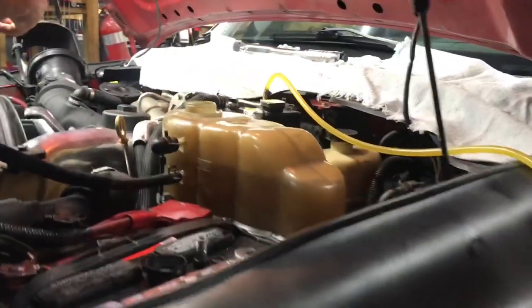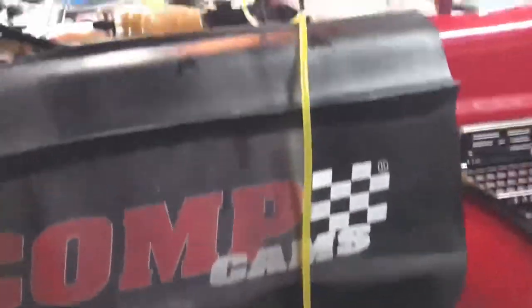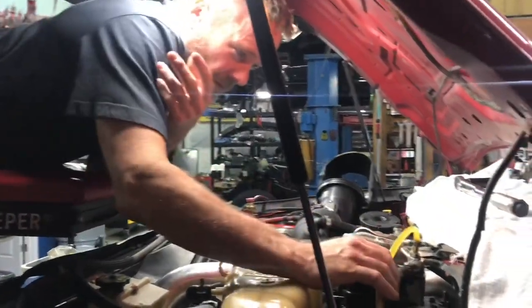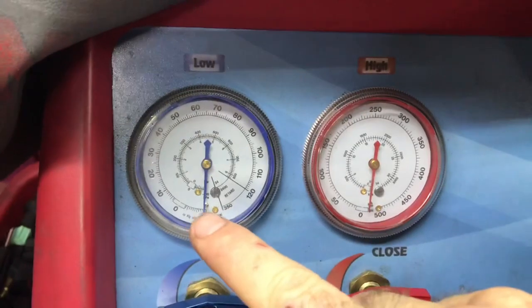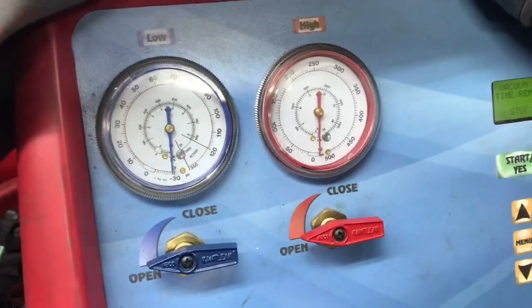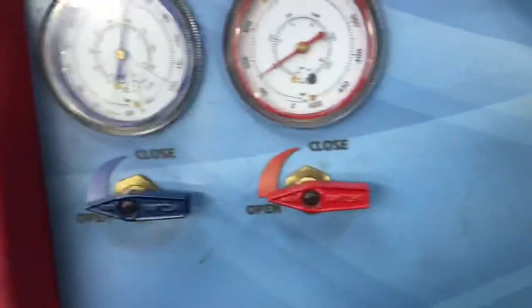So we just primed up the fuel cooler and now we're bleeding the fuel system. You can command the fuel cooler pump on — I don't know if a lot of people do that, but you can command it on and prime out the fuel cooler system. Right now we're priming out the fuel system — go ahead and kill the key, it's good. Just an update on the AC: when you're down that low, it's been on vacuum for about an hour now. We'll pull another quick vacuum on it and then fill it with freon. All right, it took it pretty good up to 64 so now it'll start pushing it in — the machine kicks on and starts pushing the freon in.